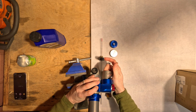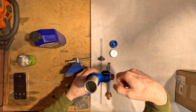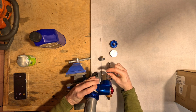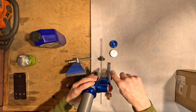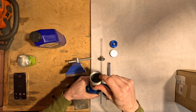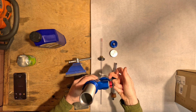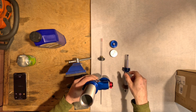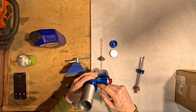I'll push the IFP all the way in. Then using compressed air, I'm going to have a little stopper below the reservoir so that the IFP isn't able to pop all the way out, and I'm going to use compressed air to push the IFP back down, ensuring oil does not drop below those IFP ports. Then I'll push the IFP back up, and we'll do that a few times to get all of the air out of the high and low speed adjuster.